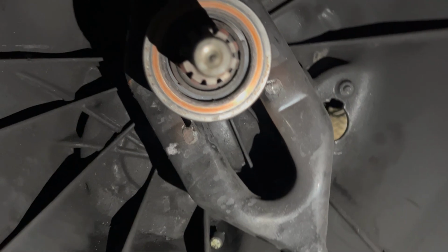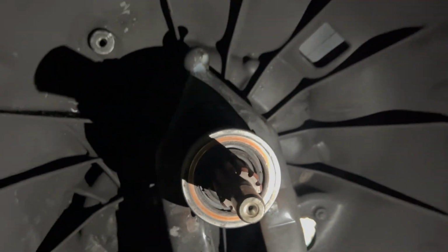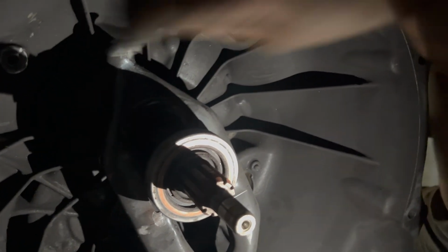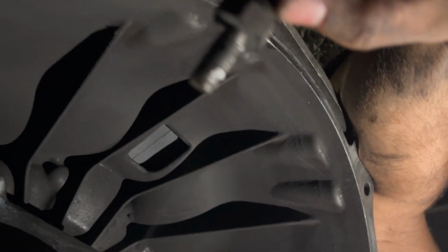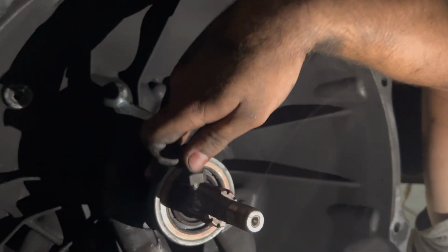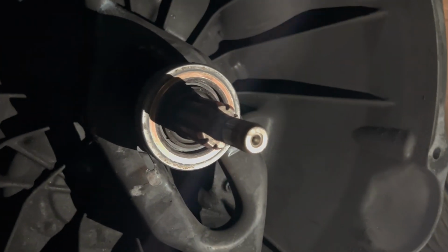The main issue we found here is the ball right here. On the G56s, whenever you put an aftermarket clutch in, you gotta take the washer and everything out. And apparently it's smart to use Loctite for this thing. But it has boogered up the threads, probably where it was beating around in there with the clutch pressure plate. So I could grab one of them tomorrow. Throw-out bearing feels smooth, it's quiet. Clutch looks good. Throw this bad boy back together.